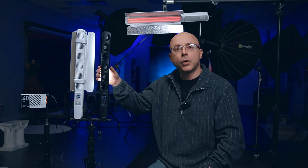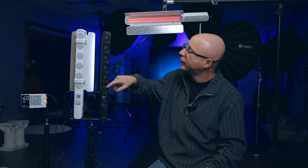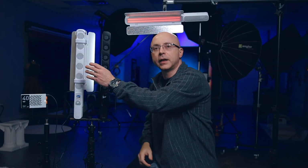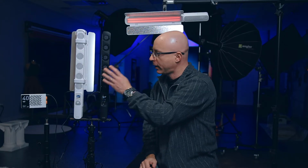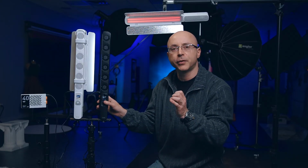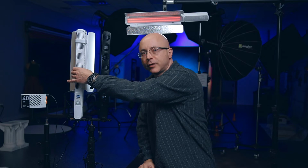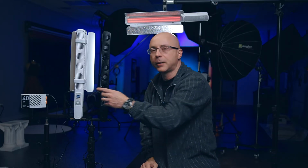This is actually a 100 watt light stick, so get used to the fan because there's no way to not have fans. This light, and yes, you're gonna be having all 6 fans here. So the difference between this one and this one, that also has been an improvement. This fan here, regardless the temperature that you are in, as soon as you connect this light to 11%, that's when the fan kicks in, regardless. And this one here, it depends on the degree of level of temperature that reaches inside. Here, that's when the fans start to spin, but they start spinning very gently, very slowly until it picks up. When you connect this up to 100%, yes, the fans are going to scream, whether you like it or not.